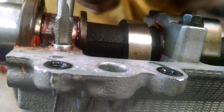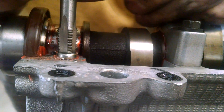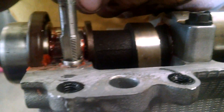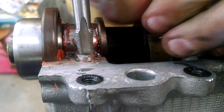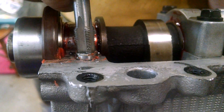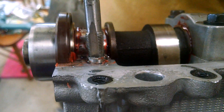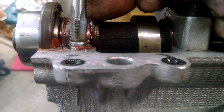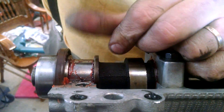I'll clear these threads one time just for chips. Hopefully you'll see this work like it did on the other ones. There it goes. Now I'm gonna back this out so I can get the tap out of here fairly easily. I've got some decent moving threads there, but now I'm gonna crank it back down so it binds and I'm gonna pull while I'm turning it to the right. You can see it's coming out. There it is.